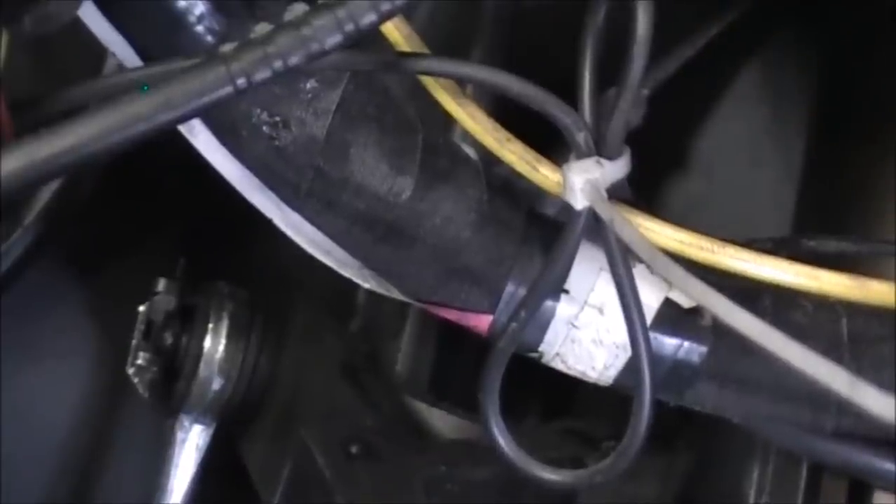The reason I had to do that for my truck is — up on top inside the steering column, above the steering column is the clutch housing assembly. And inside that assembly is the brake pedal and the clutch pedal shaft pin. What has happened to my clutch is that that shaft pin on the clutch side — either the bushing or the E-clip has come off the end of the shaft and it's caused an awful lot of play.